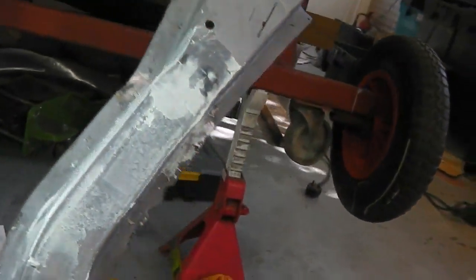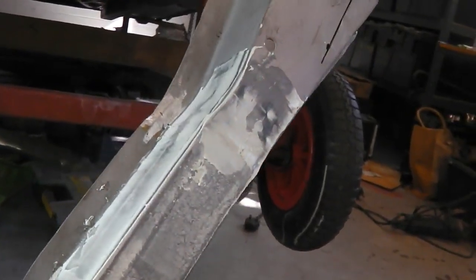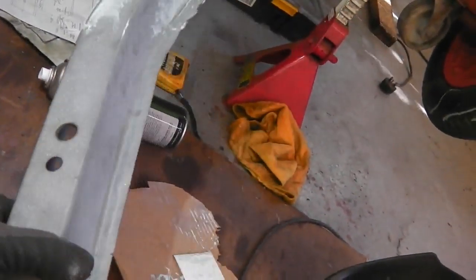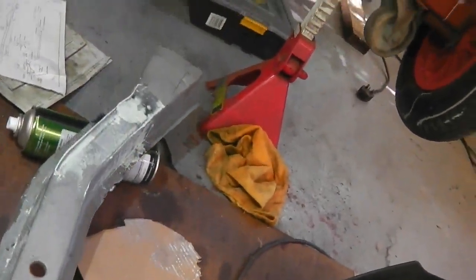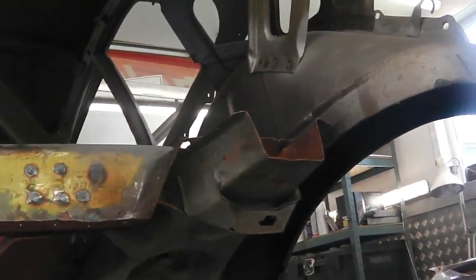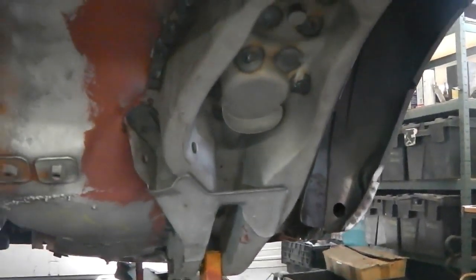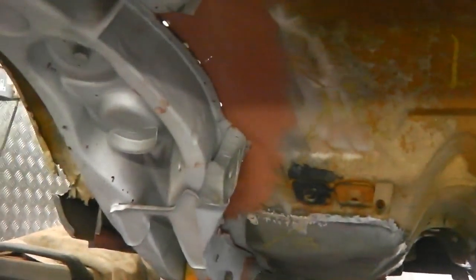That makes sense. Whilst I've been saying that, this is probably almost cured. It's fast curing stuff. We can flatten that back with some just light grit paper. These can go into paint because they don't want them flash rusting, because they're nicely shot blasted and clean. We paint the insides of them, treat them, then we'll get them into here and then start checking the measurements as opposed to that sheet, because whilst this side was not done with that sheet, it was done with part of that sheet, but not with the relative positions of this side.